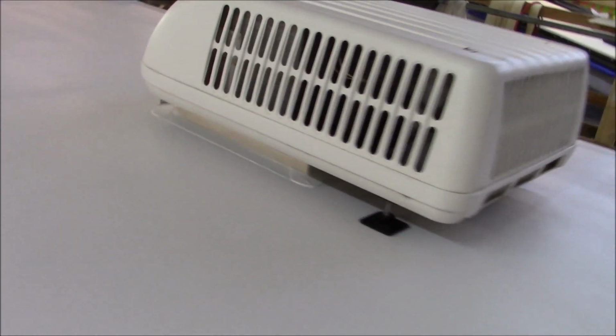And then all of that curb is all welded, the whole thing, not just the edge, the whole entire curb, the whole flange is all welded in there. And then on these curbs, I have counter flashing that I built into these. Now obviously we're on the back side, but we'll go around to the front here. We'll look at this shower lens we cleaned up a little bit for them because we couldn't get a replacement, but we epoxied all that back together for them.